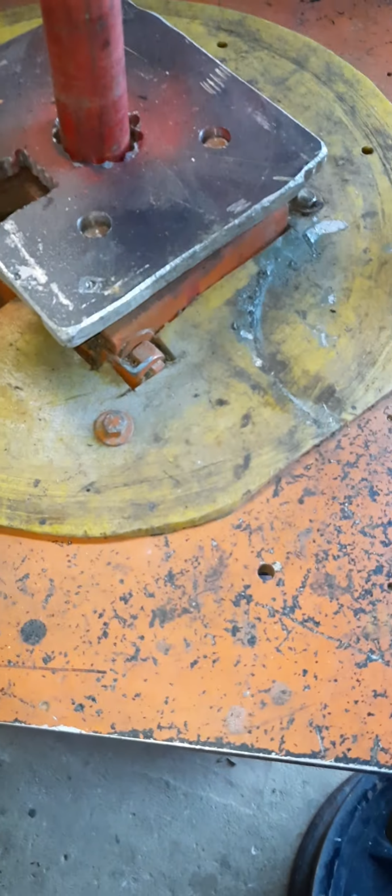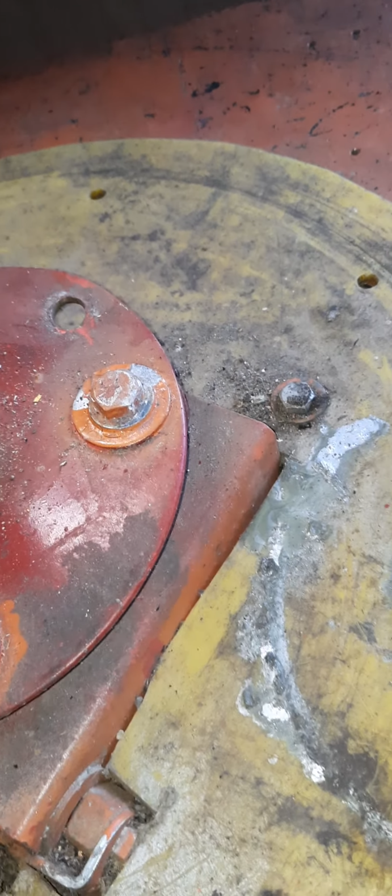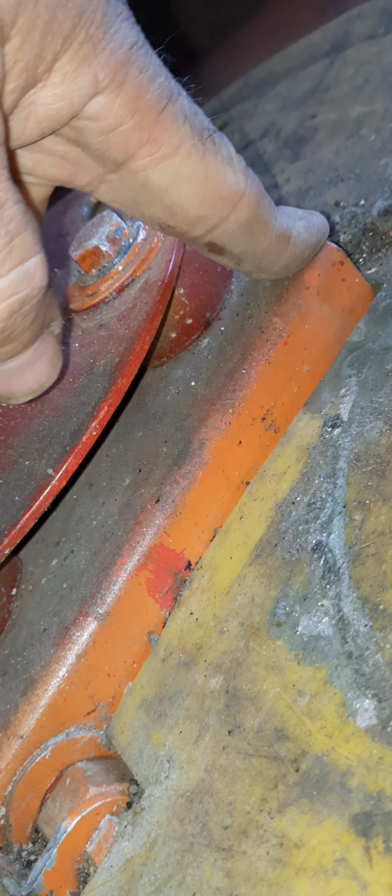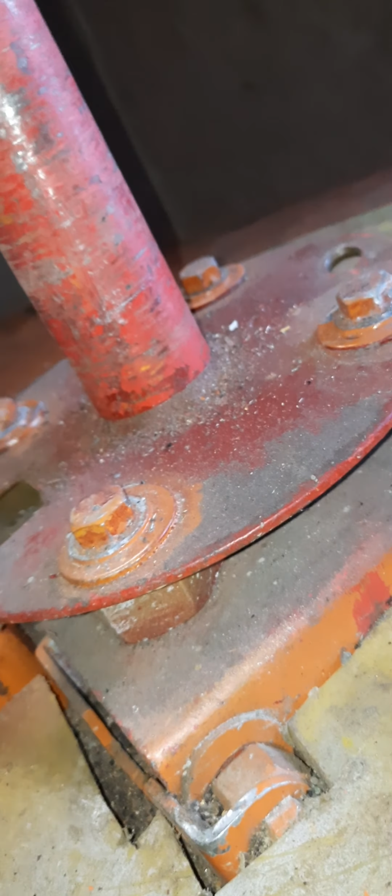And I'll show you what I did here. This is aluminum plate that I added. And here is the original base. And then I notched it. And I bolted it. And I put some spacers in here. And then these pieces came off of the tripod, or the legs, the feet, off of the Harbor Freight base, and I drilled it through to make it stand up higher. So I made this to mimic within, I don't know, a 1/4 inch, 1/8 of an inch of the old Coates machine. So I used the Coates measurements.